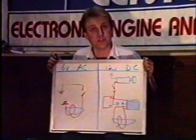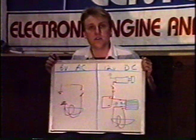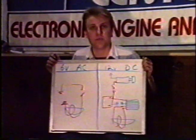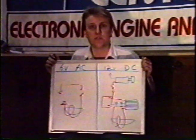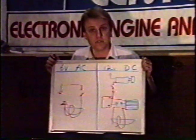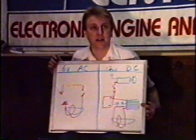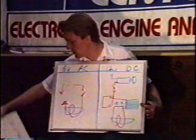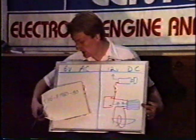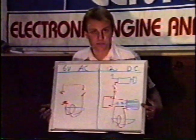To convert this simple 6-volt AC system to a 12-volt DC system, which you'll need to power your gyro endlessly for those long wheelies, the first step is to send your stock lighting coil to Ron Bishop in Escondido, California. He can rewind the coil for increased amperage and make it work well with a 12-volt DC system. The next thing you'll need is a regulator rectifier unit. This Yamaha part number, 3Y6-81960-A0, works very well with this particular setup.